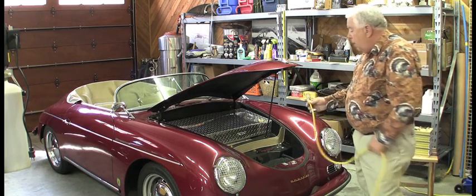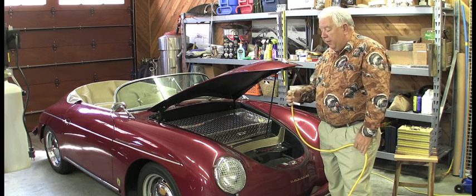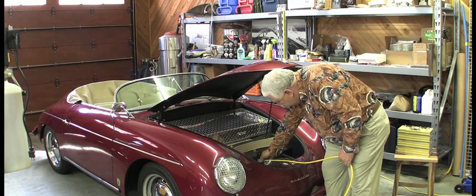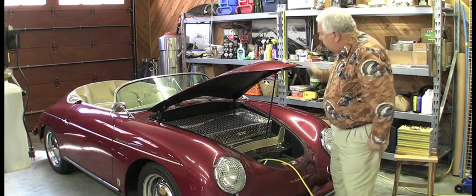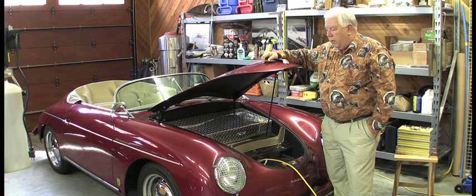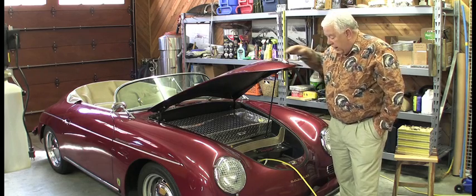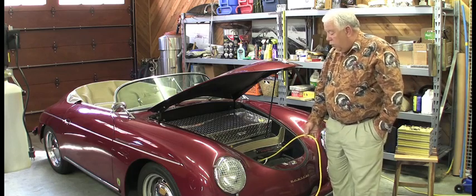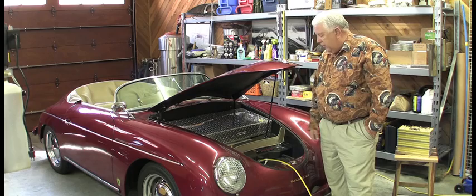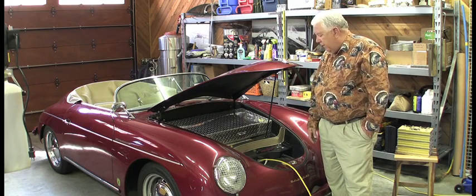I have a cord here in the garage made especially with a 240 volt connector on one end and an ordinary 120 volt AC female connector on the other end. We lift the weather cover, plug the cord in, and walk away. We use the three-prong connector, which is somewhat unusual when using 240 volts AC. The cable and connector are nominally rated for 15 amps, and this is a very heavy cord — you want good quality, not a lamp cord — with well-insulated heavy connector blades and actually 10 gauge wire within the cord, well able to carry the current for a short distance of 20 or 25 feet.